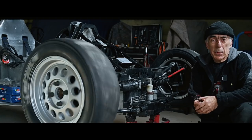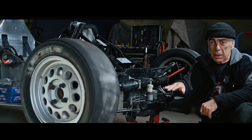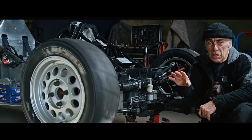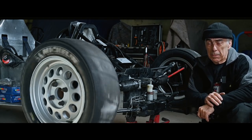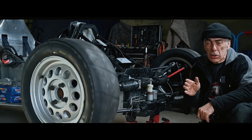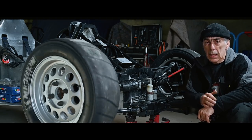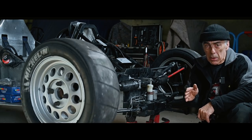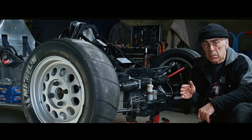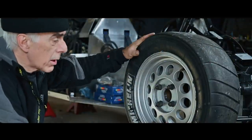These are the new master brake cylinders that we'll install in the next episode together with the rebuild of the calipers. The main purpose of a suspension is to keep the wheels on the tarmac — they should be able to move up and down but always stay in contact with the tarmac. The second role of the suspension is to make sure the contact surface of the tire is always as large as possible. So let's start with the tires and the wheels.